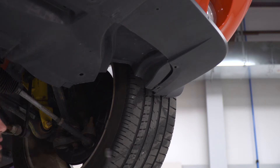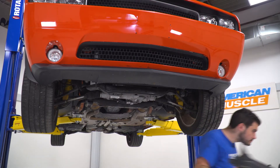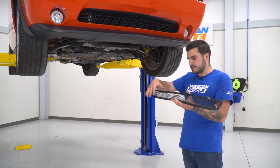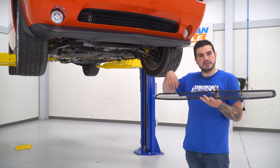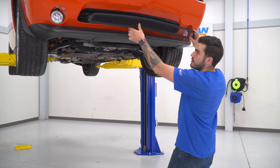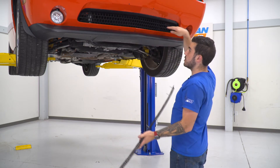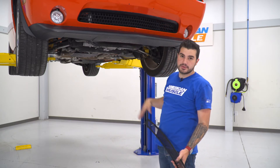Now we should pull the entire piece off in one piece and set it aside. This next step may be a little bit of trial and error, but you wanna take the lower mesh grille overlay with the studs pre-installed right out of the box. If yours were not installed, you're just gonna screw them in by hand and then use the Allen key included in the kit to tighten them down. You're basically gonna, trial and error, put this guy in place on your factory grille. You may have to start at one side working your way over to the other to make sure that the studs push all the way through to the inside of the factory grille, then we'll head underneath and tighten them down with the hardware.